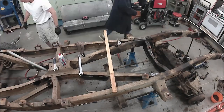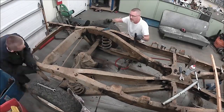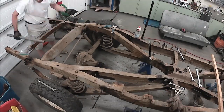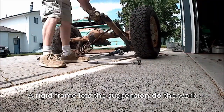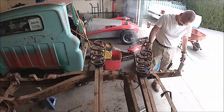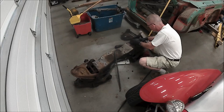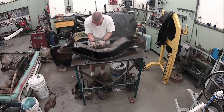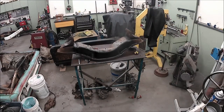Driveshaft came out — probably not going to reuse that. I've got trailing arms out, got the back axle out. You can see this has got an X frame. 60-62 was built with these frames. Some say the torsion bar suspension rides awesome for ride quality — I think it's because the frame is so extra rigid. This is a front crossmember from an 84 Suburban, easier to deal with than the torsion bar. I want this thing to ride low.